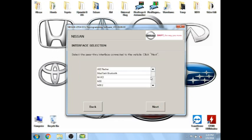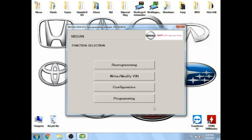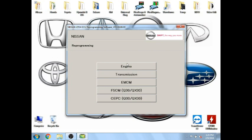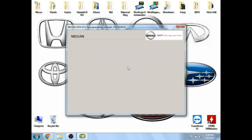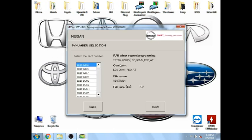So we're going to go ahead and go forward. We're going to select our VCI we're using — this one is a Bosch MVCI. Then it gives me information on my VCI. We're going to be reprogramming the engine — at least the engine computer. This takes a second. So that was probably a total of one minute. Then we'll scroll down and select our old calibration that was in the PCM — the one that we noted before — and that was ZX56 alpha. You'll notice all of them are 23710s.